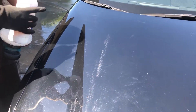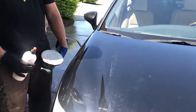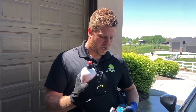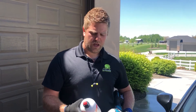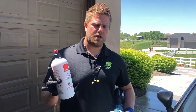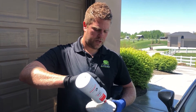This particular car has gone through the car wash a lot, so there are a lot of spider webs and swirl marks all over the hood. We're going to do our best to polish some of these out today. I'm working with a Makita dual action polisher — this is a cordless buffer, our workhorse every day — and I'm using a Meguiar's microfiber cutting pad in conjunction with Rupes Uno Protect. This is an awesome polish that also has protective sealant properties and cleans the paint really well.